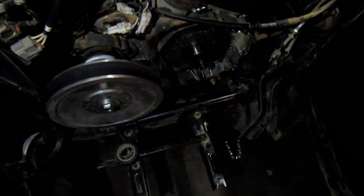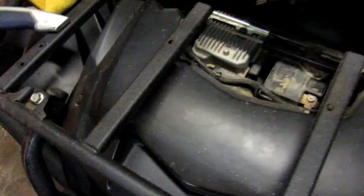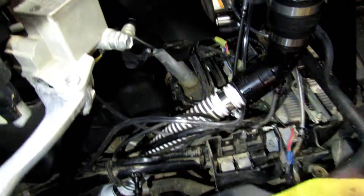Waiting on that internal primary clutch gasket, and then once we get that on we can run the other one. I'm about to take this back off so I can trim out the piece that goes right there in front of it — I've got to drill out the hole so it'll slide down on top of it. But other than that, the kit's perfect. It comes with everything, everything's the perfect length. You can turn it a little to get it straight, and all the vent tubes run up through there — you can tie them in a loop or tie them off to the snorkel.